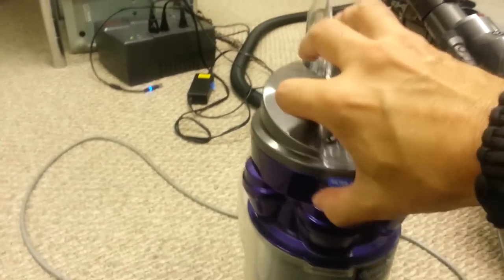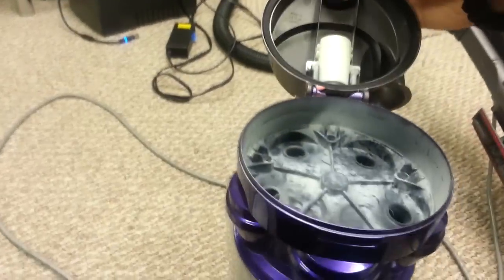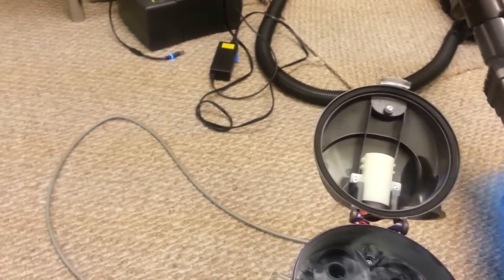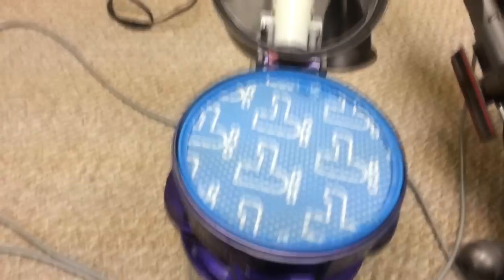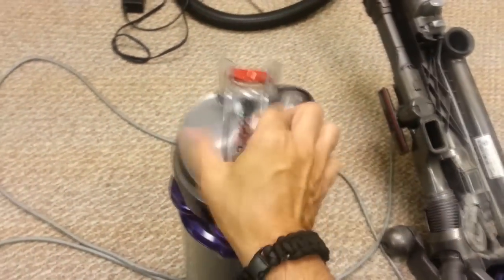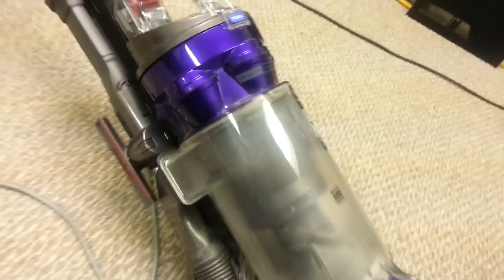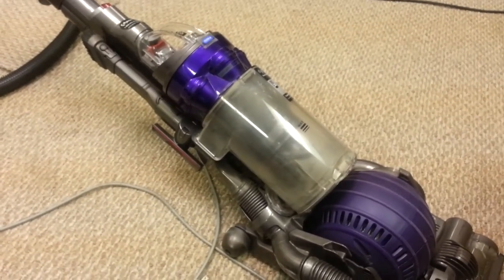And then this, look for the filter A. This kind of lifts up and pops up there. Make sure that's fairly clean, too. And then this guy drops right in here. Should only fit in the same way, which was like exactly like so. And this should click shut. And that goes back on your base. It's right in there. Match that guy up. Make sure you got a nice tight seal. Click it in good there. And let's give her a whirl. See what we got.